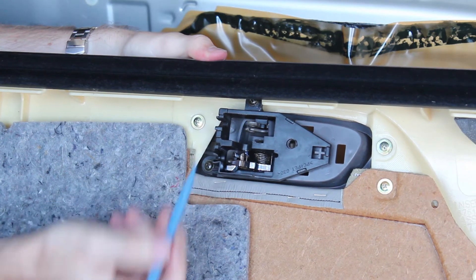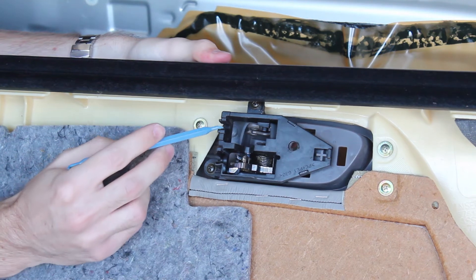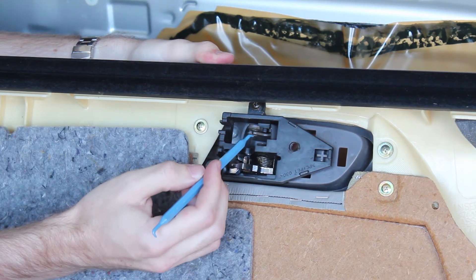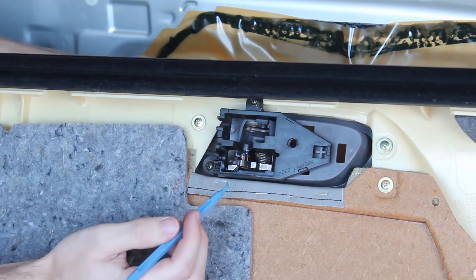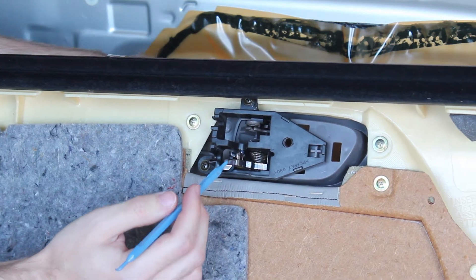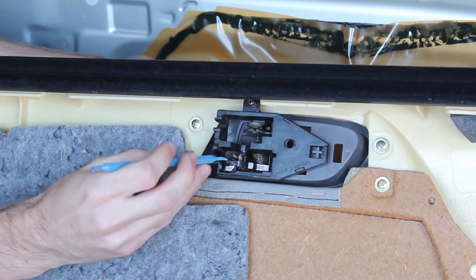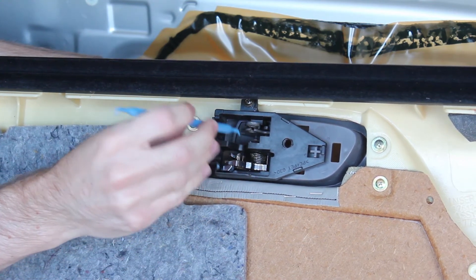This is the door lock switch right up here, and this is where it connects to the cable. Once you've removed the cable from the slot up here, you're going to wiggle it around so the cable can exit down through this slot and then the ball will just drop out the bottom. Similarly, down here you can see the chrome piece — the inside part of the door handle — and the cable exits through here, coming up through the slot with the ball end exiting through the top.